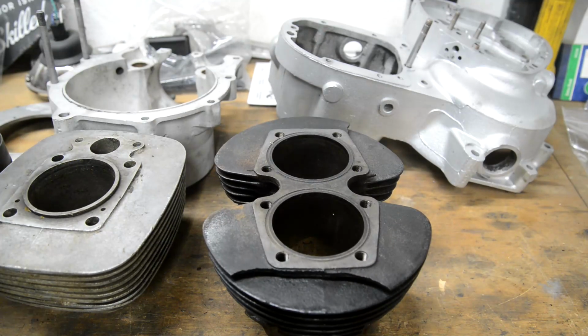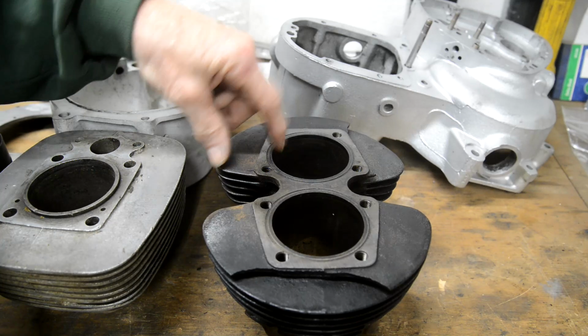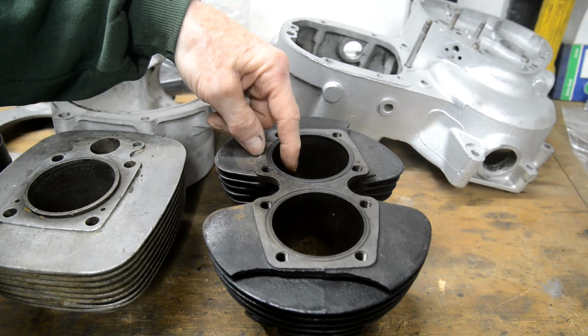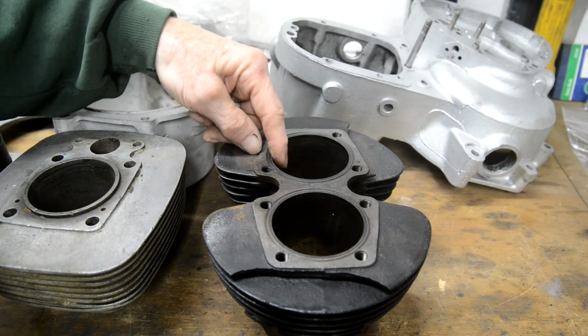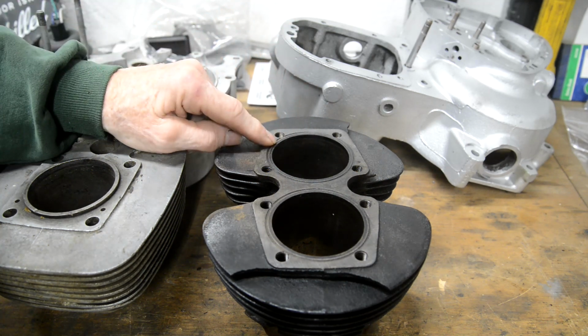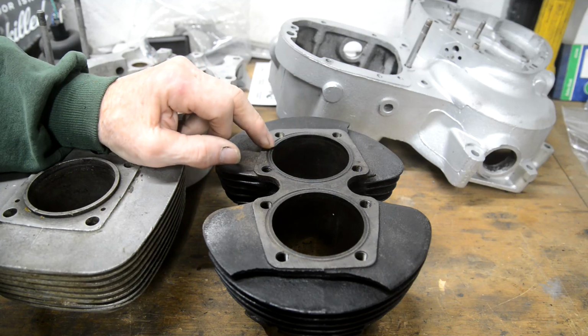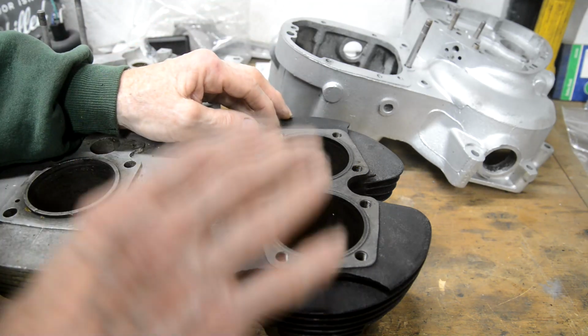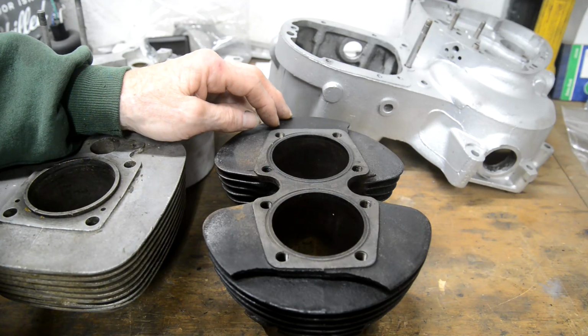Now of course you say, well, wait a minute, I thought they used the KZ pistons. Well, they did, because this is 69, the KZ piston is 70, so it's only 40 thou. It's only like 2 overbores. It's only gone plus 40 thou. So there's no way I can put a liner in there that I can see.